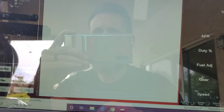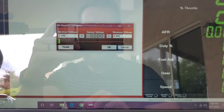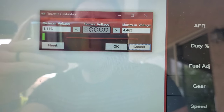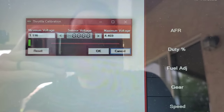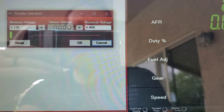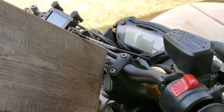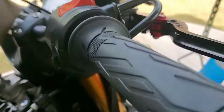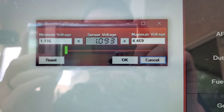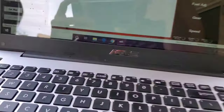I'm going to go to Calibrate, then Throttle Position. Now you can see what we're looking for: the minimum voltage shown is 1.1. Based on what I've read, you want the closed-throttle voltage between 1.10 and 1.14, and wide open is around 4.4 to 4.5. I'll put the ignition on the bike — the sensor voltage is reading 1.0, so it's just a hair below the 1.1 target.